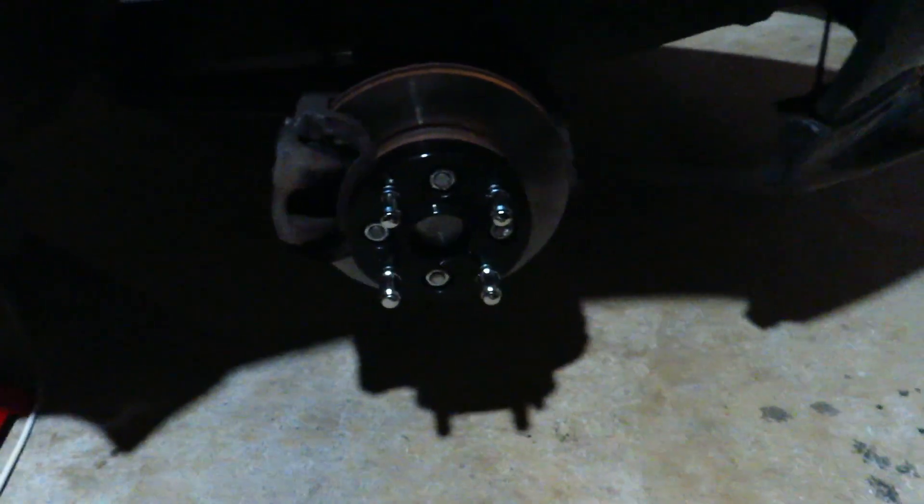The wheels are now back from the tire shop — thank you to my friend Miao Lin for doing that. Before we square away these tires and rims, I'm going to tighten up the four nuts on the adapter and hub to 105 Newton-meters, just in case.